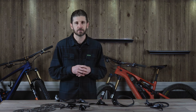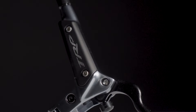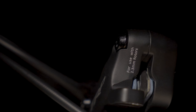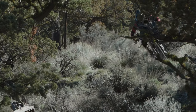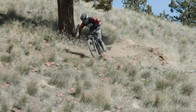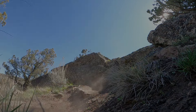Something else that's really neat about these brakes is that there are no 90-degree bends inside — the fluid can smoothly and freely flow, improving lever feel and performance. TRP has put a lot of thought into how oil flows through their calipers. There is also a lot more oil in these systems, which makes it harder to heat up and resist boiling. It also means you don't have to bleed your brakes as often.